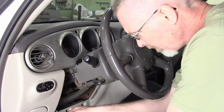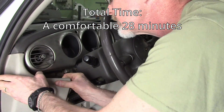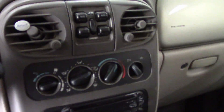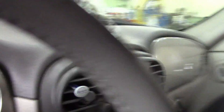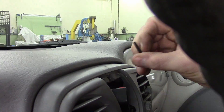The centerpiece pops down and falls by your feet. Two screws in the side panel — give it a good enough yank and it comes right off. It's held partly by the rubber door seal. The knobs for the heater controls pop off easily. The putty knife pulls out the power window switches. There's a safety connector in there that needs two hands. There's one screw in the top of the hole centerpiece.